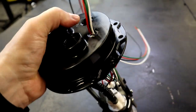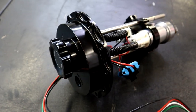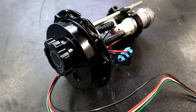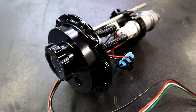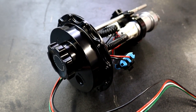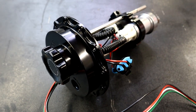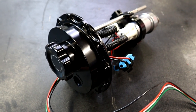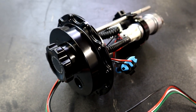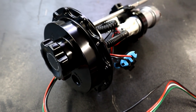It flows a lot of fuel and this thing is very well made. So the biggest thing everybody's going to be interested in: this fuel pump can support up to 1,750 EFI horsepower at 60 psi. On E85 we will definitely be able to flow well over a thousand horsepower on this fuel pump module, so this is going to work perfect for our E85 swap on Frostbite.